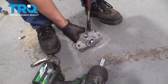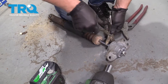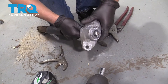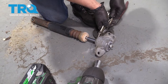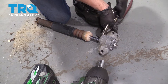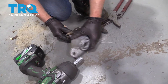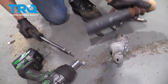It is going to start spinning the studs. So what you need to do is slide this down at this point. The correct way to do this is with a special socket that goes in there so you can hold the shaft from spinning. But what we're going to do is use some locking pliers up at the top. This isn't going to cause any damage if you had to reuse it. Lock it down, take this nut off just like that, and we can slide that off. Slide the bumper and the sleeve off.